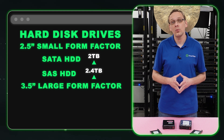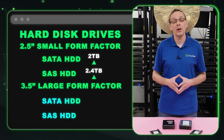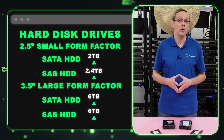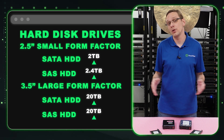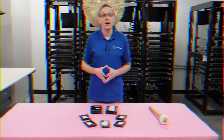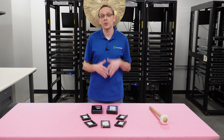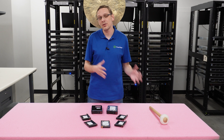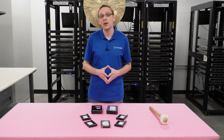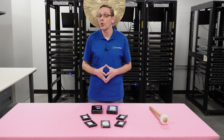When you go to the large form factor, that's where it gets a little different. Both SATA and SAS hard drives show 6 terabytes on the HPE spec sheet. We've put in 20 terabytes for both, and I wouldn't be surprised if someone's dropped in 22. That's older information on the spec sheet, and that was one of the reasons we wanted to do this video — even though this is an older system — to let people know that yes, you can go off spec and put in larger drives overall.